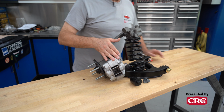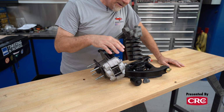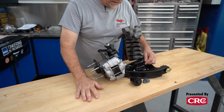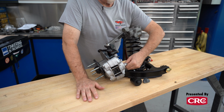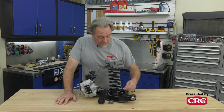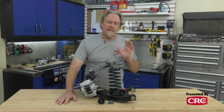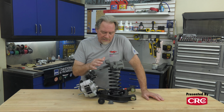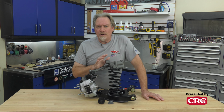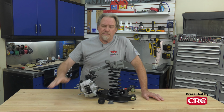So the only thing we've done to these brakes, and we've done a video on how to rebuild these calipers, is we've added these Goodridge stainless steel lines. Although they look like a stock rubber line, they are a braided steel line underneath. They're available now at Moss Motors. We love these braided lines. They're less likely to get injured should they rub against something, and they do improve the pedal feel. It's a common misnomer that they make your brakes better. They only make the feel better, but they don't change your braking distances.